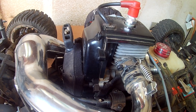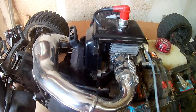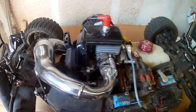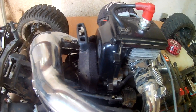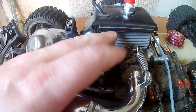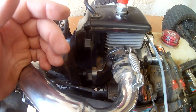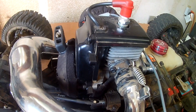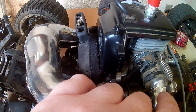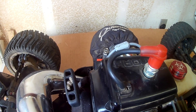The engine on here — I did a few other videos talking about it, but the engine was running and you probably couldn't hear me well. The XCR has a Zenoa 290 with a rebuilt head. This engine was actually from my Red Cat Chimera. It got a ton of dirt in it — I had a TGN air filter and it just totally screwed up the engine. I took it apart and there was dirt in it like crazy.